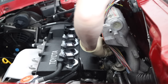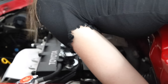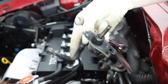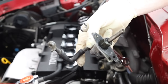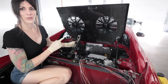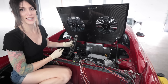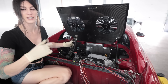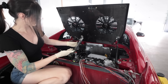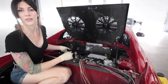I hate working upside down — my nose is running inside the engine. I'm having booger water inside my injector holes. That right there is the cold start fuel injector that will be replaced with an IAT sensor. This right here is a side-feed injector rail. I'm replacing it with a top-feed injector rail, which gives me better options for fuel injectors like the 1050s I just bought. And this thing looks like trash, so I get to get rid of it.